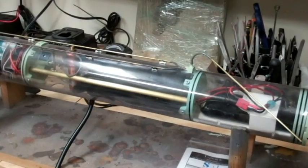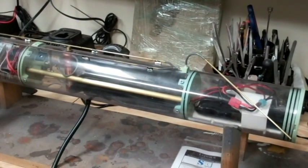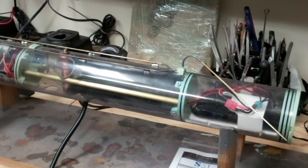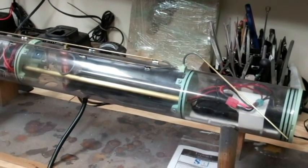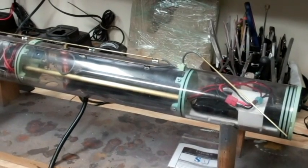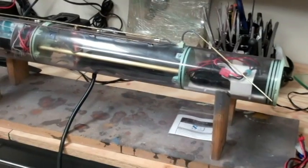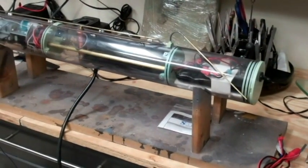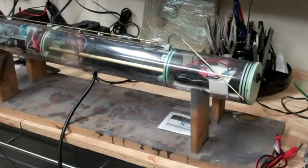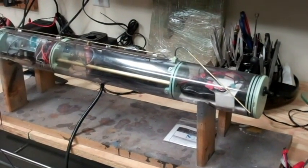For this particular model, as the new owner is just getting started, that is going to be just slightly positively buoyant so that when the ballast tank is completely full, basically the sail will still be sticking out. So if there are any problems underneath the water that he runs into, he can just simply take his hands off the control, put everything to zero, and theoretically the model should surface by itself.